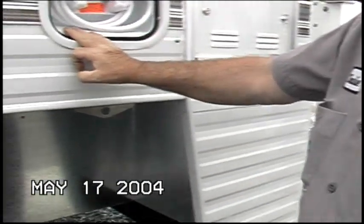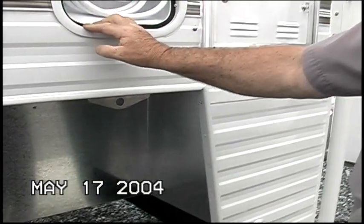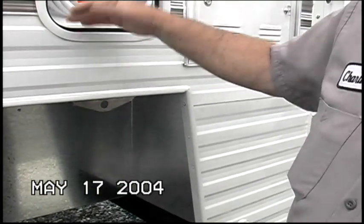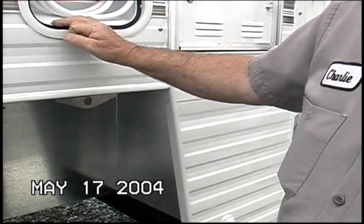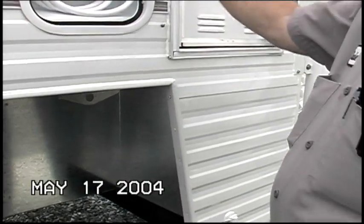When you winterize, make sure you get antifreeze through this system. If you don't, it's going to freeze the hose up and bust it. Some models, I don't know if this model does, have cutoff valves inside. I've seen a bunch of valves in there for winterizing and stuff. I'll show you once we do it. I was looking around in there.